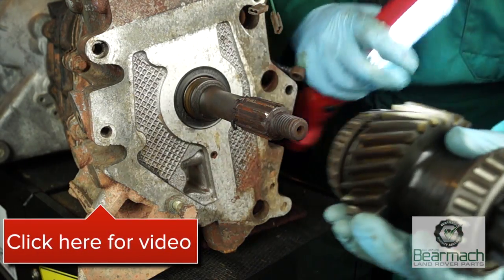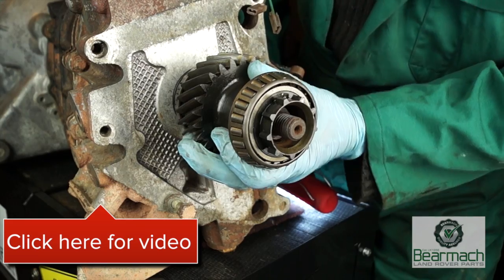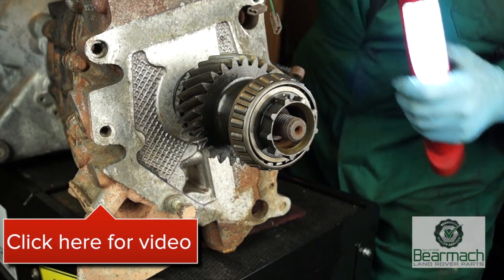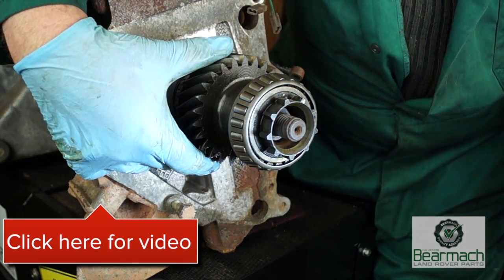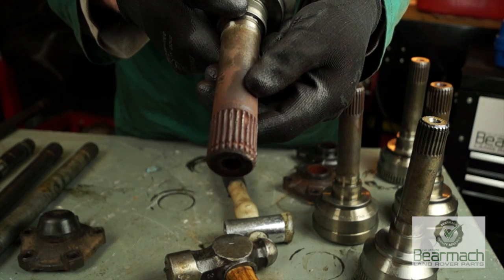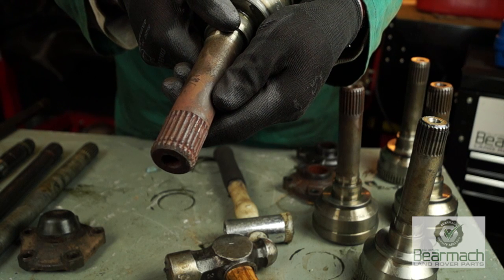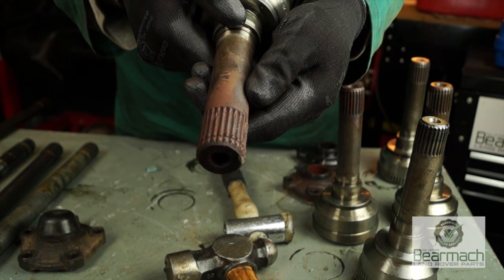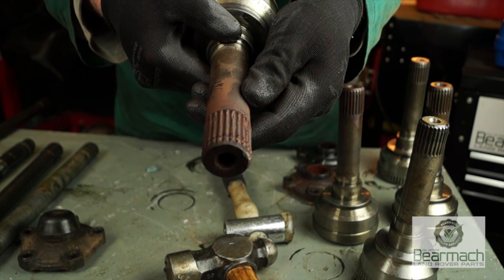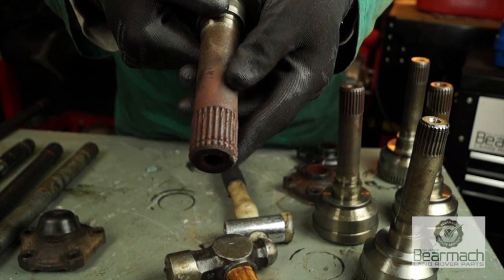If you're not a regular, have a look at our LT77 video where we explain about spline wear. Spline wear, once it starts to wear, just gets worse until you lose drive somewhere in your drivetrain. Okay, this CV driving member actually stripped the splines, even though there is a little bit left, and the vehicle lost its drive. So if you haven't broken a half shaft, the splines may be stripped.